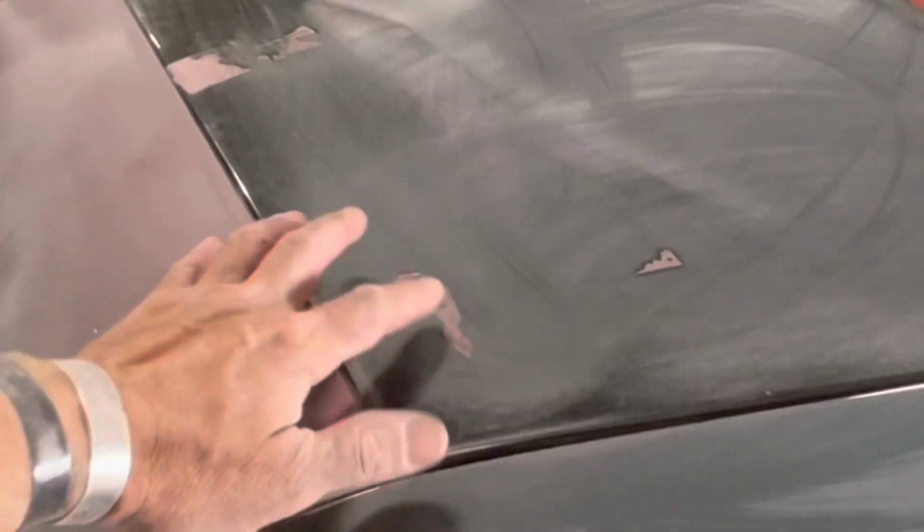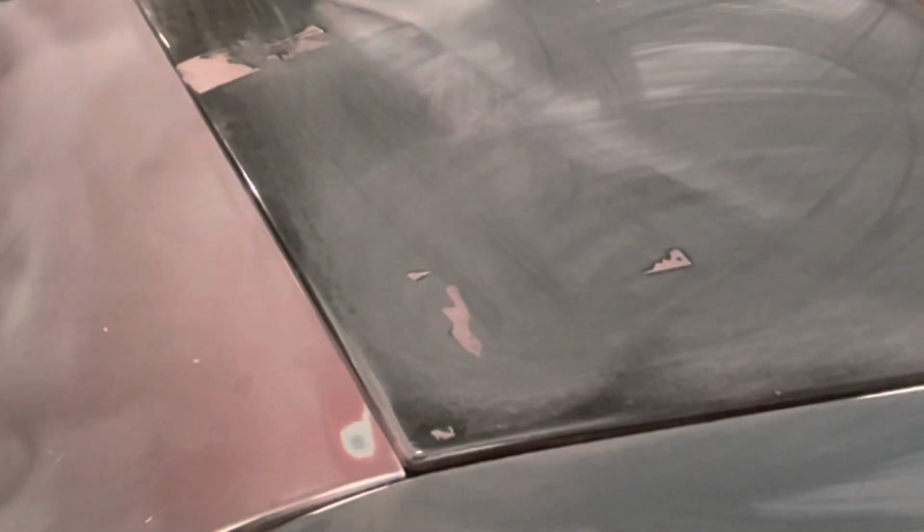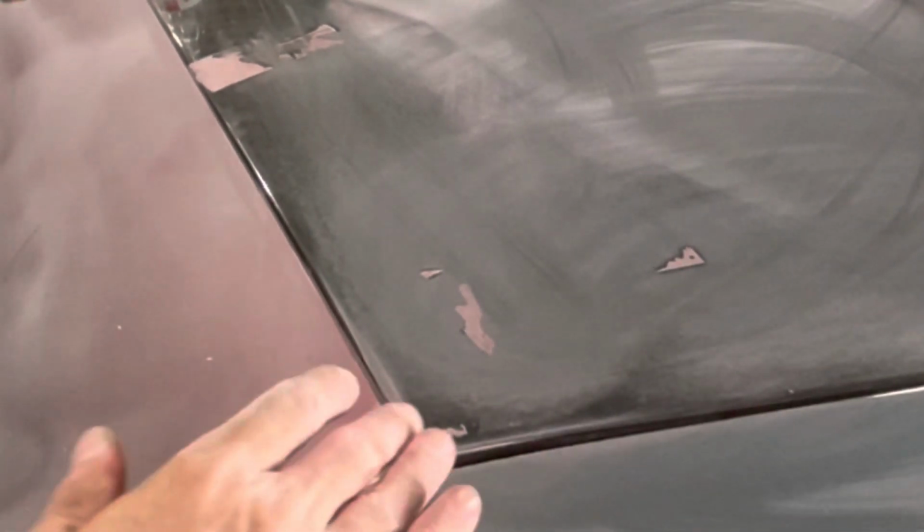You may see these spots and wonder what those are. When they shipped this to me, it was all packaged in that clear packaging tape, and that's just some of the glue residue. Some of it is sanded off, but some of it's pretty stubborn. The reason you don't want to continue to keep sanding away at it, if it's not coming off easy, is because it's going to ball up on your pad. It's going to give you a dead spot on your sanding disc. And trying to sand away at this, you can sand away the outside of it before that disappears.